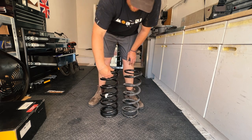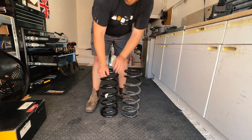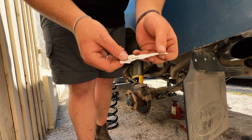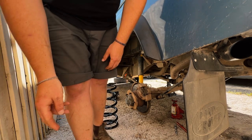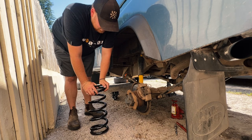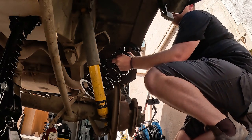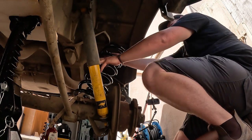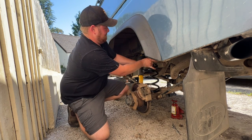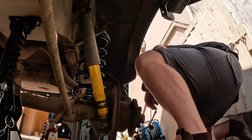The old ones had a lot more compression of coils at the top — and that was a genuine Land Rover one. This new one still has a nice amount of spacing all the way through, which hopefully means it'll be supportive but with a comfortable ride. There are so many different numbers depending on where you're getting it from, so it's worth speaking to someone knowledgeable. I spoke to the guys at Brookwells and they definitely helped me out — there are so many different options and it's handy to have someone else's opinion.